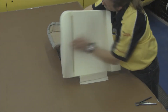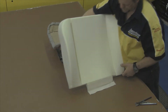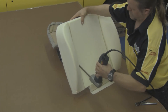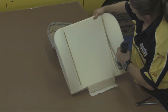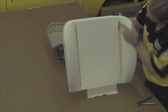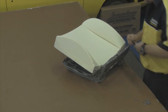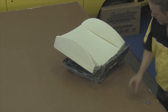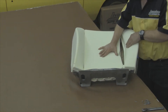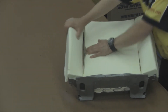Our next step will be to cut down through the channels of the foam. Be sure not to cut any longer than the channels in the foam. You'll see Randy's using a foam saw — you can use a razor blade, a pair of scissors, or mom's carving knife to achieve the same goal. Our next step will be to set the foam on top of the seat springs and anchor it through the muslin and around the seat springs. You'll know when you have the foam installed correctly when you can look down through the channels and see the listing wire we previously attached.